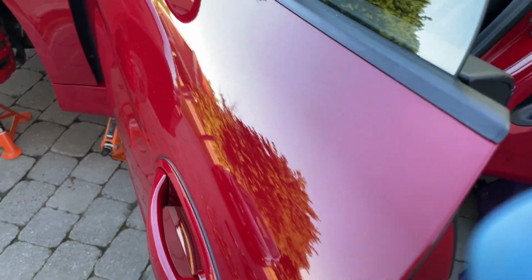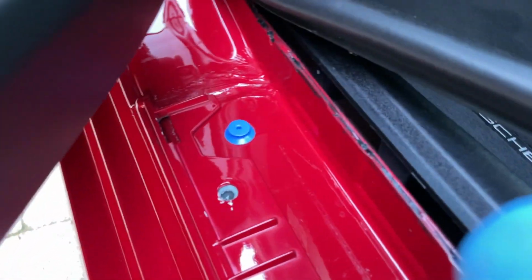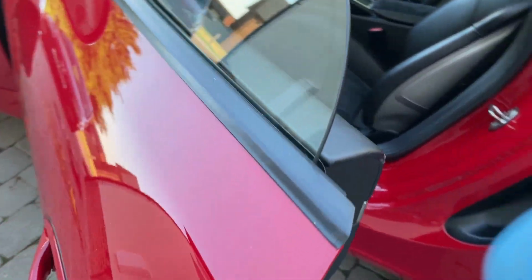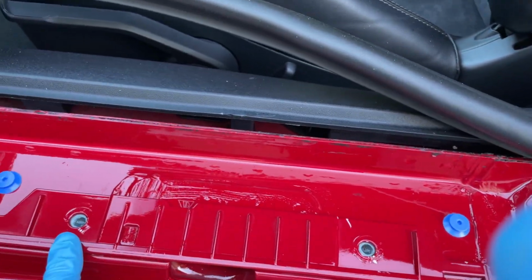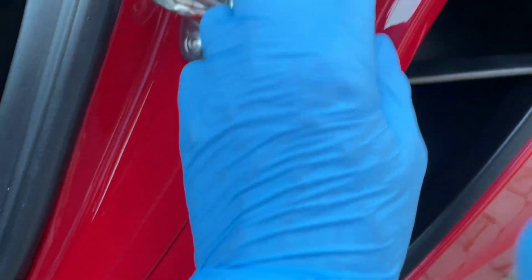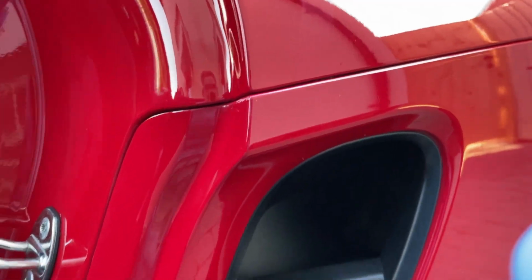So if you've got the door open fully, move it back 1 stop like that. You can then slide it that way, and it'll line up correctly. And you can tell when it's lined up because these holes here magically appear. So with that end done, work back up here, and then gently press, press, press it in, and you can see we get a nice tight finish.